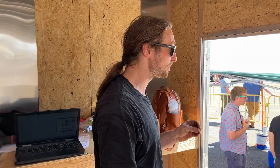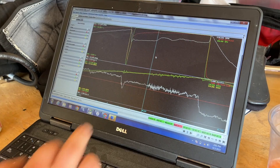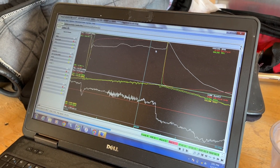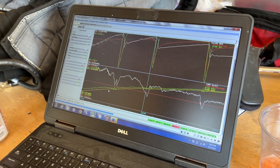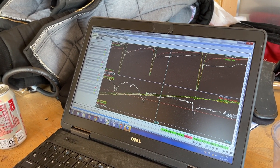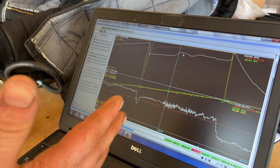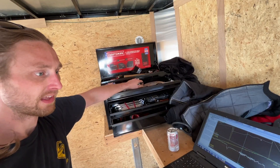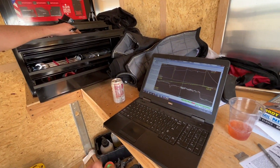Looking at the data right here in fourth gear: RPM goes from 6100 with these crazy RPM flares — that's the clutch slipping. The green line is the vehicle speed sensor, and you can see everything just shaking. Earlier in the run it wasn't that bad — a little bit in first gear, third gear was alright, but in fourth gear it was really bad. Luckily, the tuner Matt is sending updated tunes to bandaid it together enough to keep it going, which is why he was able to do his license pass today.